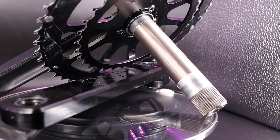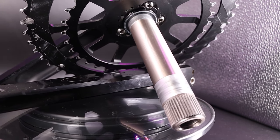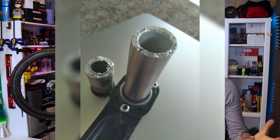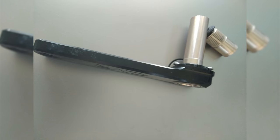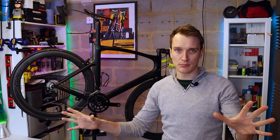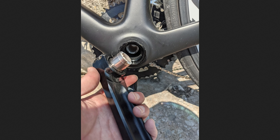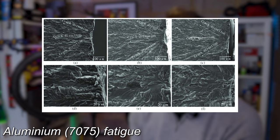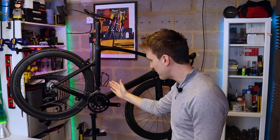But where does that leave this one with an aluminium axle? It's seemingly fine and certainly hasn't broken yet. But one of you — Paul from Melbourne — emailed me with pictures showing exactly the same crank in a classic example of failure via metal fatigue. He'd only had them about six months and was just pulling away from the lights when it snapped out of nowhere. Luckily he wasn't hurt, which is the most important thing. There's also a post on Reddit from someone with exactly the same crank that met exactly the same fate. The problem with metal fatigue is it's very difficult to spot beforehand — fatigue manifests in minute cracks within the crystalline structure of the metal, which culminate over time, and failure can just pop out of nowhere.